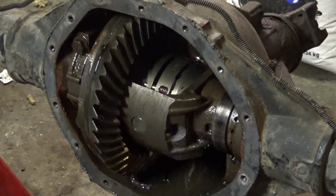And if you can see right over where the bearing cap is, at one time the bearings got hot. Probably explains why this rear end was howling. Part of the reason why I got rid of this rear end, besides the taller gears. One day it just started howling up inside, and I could kind of see why now. Well, it sat for 2 years and it was plumb full of rust too. So it is what it is, but now I can pull stuff apart and get the new gears in and give you guys a step by step on it.